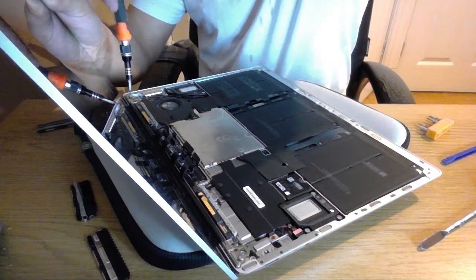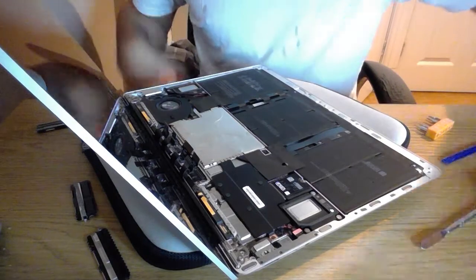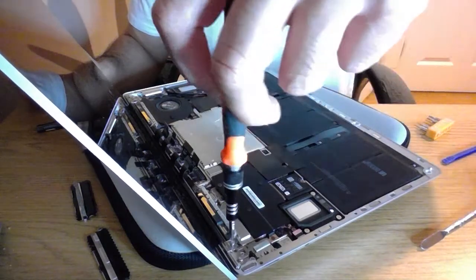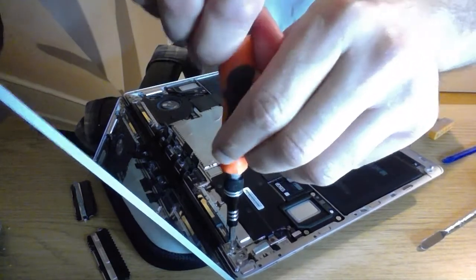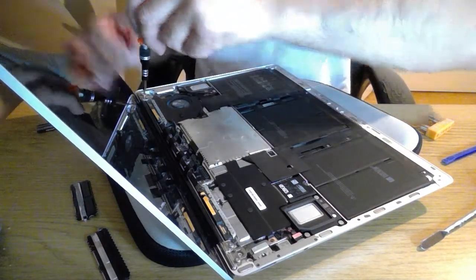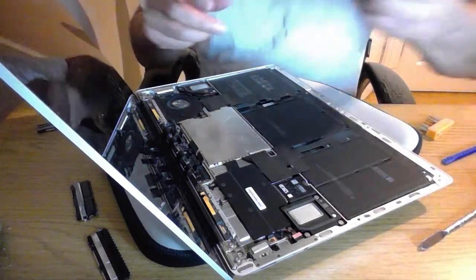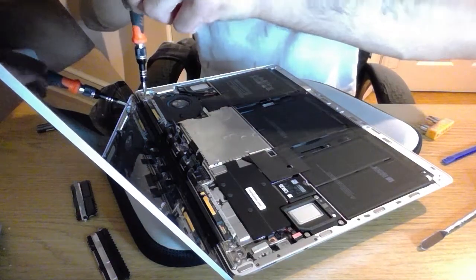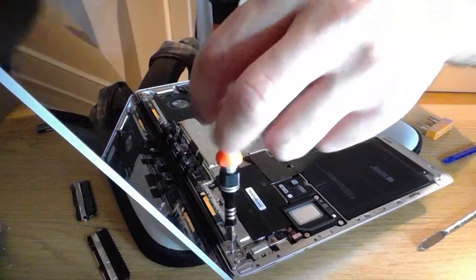Alright. So once you've got 2 screws in, life is good. You can let go of the screen and be in a position where you think, this is good, I can do what I need to do. So that one goes in next. I am literally just going to go up and down, put the 3 screws back in each side. It is a big positive though that you can now do things like this, because I think I read that the Surface Book 3s have issues with screens cracking, especially on the non-Alcantara ones.